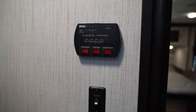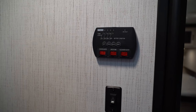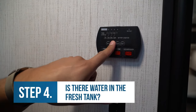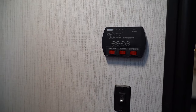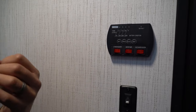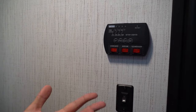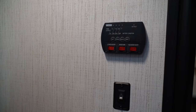When you have a travel trailer, that is often where you'll find your tank monitoring panel. The first thing you're going to want to check if you fill up your fresh tank and you don't have water pressure is to make sure there is actually water in the fresh tank — you'll see this one does not. What can happen is you can have your fresh tank valve open from the last time you drained it, forgot to close it, and when you filled it up the pressure going in was higher than that going out — so it filled up and then drained out on your way to your destination. Hopefully you have water nearby so you can just fill it up — a super quick and easy fix.